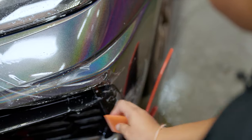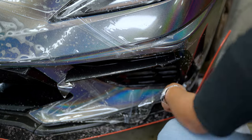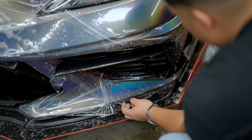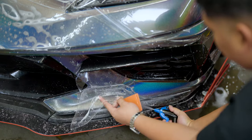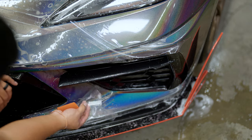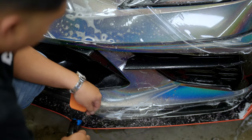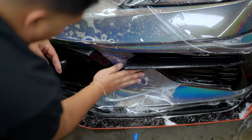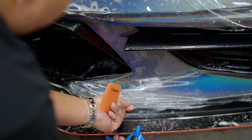And then you just want to work your way down. Some areas are going to require some stretching, so make sure you get your slip solution sprayed under that film. Spray your tack, line up your film, hold it in place — and now it's not going anywhere. Then just repeat that same process: spray your film and lay that film down. Now we're going to work our way towards the center, working piece by piece. Make sure your film is moving freely, and you're going to spray some tack where you're going to tack, which is really the top points. Spray some slip solution so you can move your film. Now we're just going to pick the film up from the bottom, spray some tack, and work our way down.